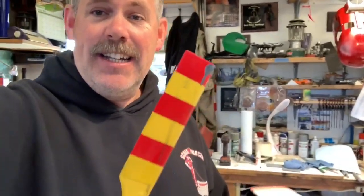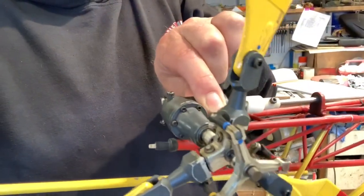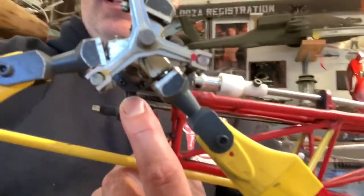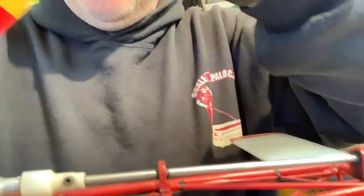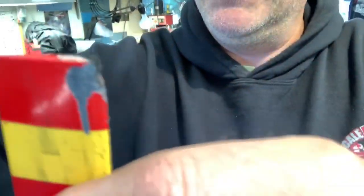Today I decided to check the nylocks on the bolts holding these two nuts right here — there's one on this side and one on this side. The best I can theorize is that the heat finally cooked out the nylock and I lost the two bolts. So I had one bolt holding this one right here, holding on the whole tail rotor. It was pretty windy today, so it rotated around and made contact — all three of my tail rotor blades are chunked and missing.